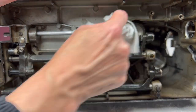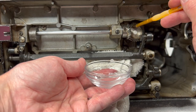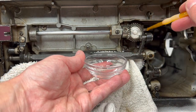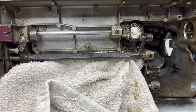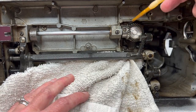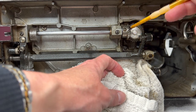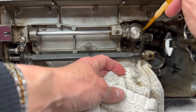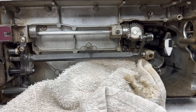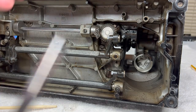I prefer to clean out the bottom after the top. I'm wiping the gears off, stuffing a towel in, and applying alcohol with the paintbrush. I'll keep doing this until I really feel the gears are as clean as I can possibly get them — it'll take several passes. Feel free to grab a toothpick to get into the little teeth. I'm dropping alcohol onto the gears, flushing off the dirty alcohol, wiping the brush on a towel so I'm not putting a dirty brush back, and just keep going. Once satisfied, an old T-shirt with rubbing alcohol continues cleaning the inside of the bottom. Make sure you get up in the hole where the motor goes — all that varnished oil needs to come out.